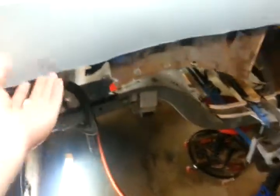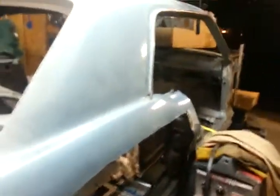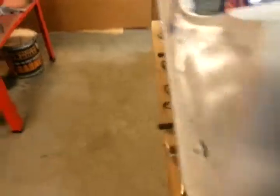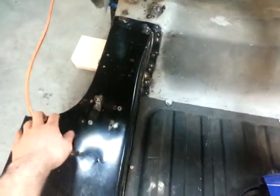That's an excellent agenda — to get these tubs in place. Once I get the tubs in and get that frame piece in, I'll be able to start working on this quarter panel because I need that outer wheel piece to kind of hold the quarter in place and give me a little bit of an alignment. I'm going to have to go pull the doors down from the attic — those are fun since I still have the glass and they're quite heavy. But I'll have to put those back on so I can get my quarter panel gap somewhat close. Then I get to get those quarters put in. And the next video you'll see those frames in place and then this piece chopped out, because I've got to cut in a good bit to get those mini tubs in.